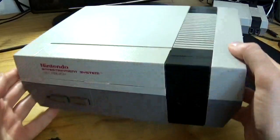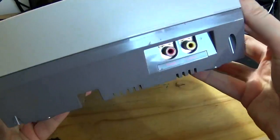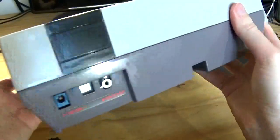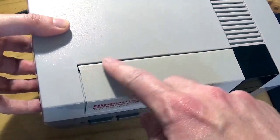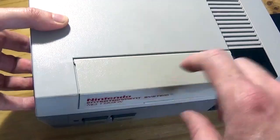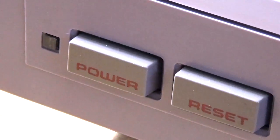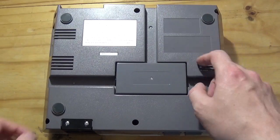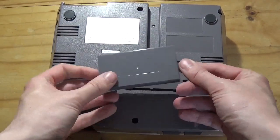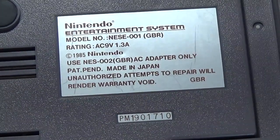Okay so let's take a look at the unit I've bought. On the side you can see the RCA ports for composite video and mono audio, and on the back we've got the 9 volt AC mains in and a third RCA jack used for UHF RF out. One thing I did notice was the distinct yellowing on the front door and the power and reset buttons — it's odd, the rest of the unit seems fine, which makes me wonder if this is actually a parts machine. Looking underneath, there are no helpline labels but the never-used expansion slot cover is still intact.